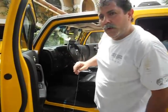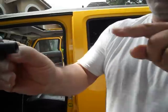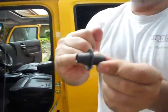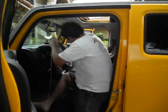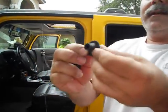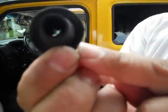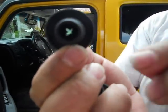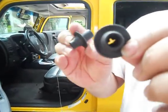Now, on the end there are these pieces — the tube connects here and this side connects to the firewall; this is where it drains. I think this is actually the problem. This piece has a tiny hole — like a cross-section — which I guess keeps out bugs or whatever. But that's where all the muck gets caught up. What I did was drill it out. You've got to stick a drill in there and take your time — it takes a little while to get it all out.